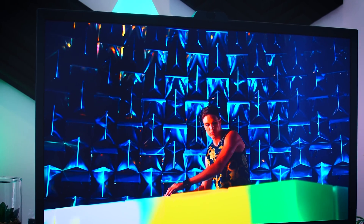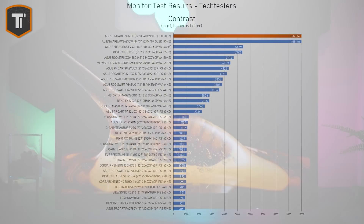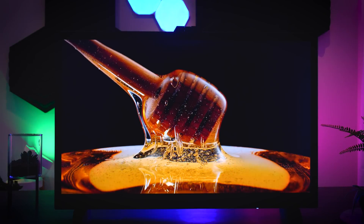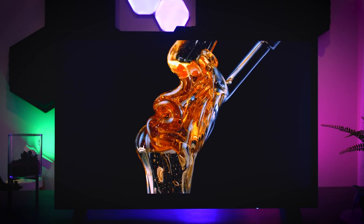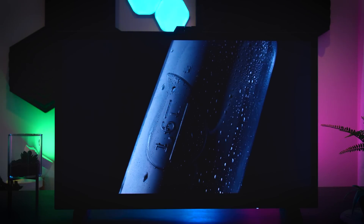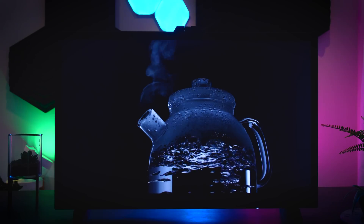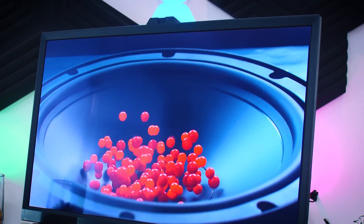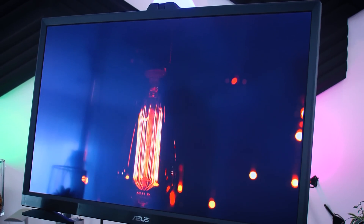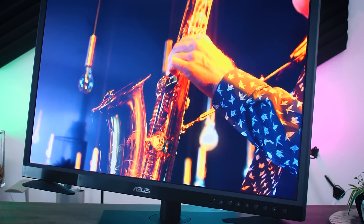Viewing angles are perfect, both horizontally and vertically. Since this is an OLED panel, backlight bleed isn't something you need to worry about, and you get infinite perfect contrast. So you get this amazing picture quality with lots of colors and deep blacks, as long as you use it in a dark or dimly lit room. Because if you use this monitor in a medium to very bright room, it does get a little more complicated. This isn't a super glossy reflective panel like typical OLED TVs, but it also doesn't have that matte coating like IPS monitors. It sits somewhere in between, and reflection can still be an issue. So if a lot of light hits the panel directly, those perfect blacks can look pretty grey instead, which kind of ruins the whole concept of that infinite contrast.